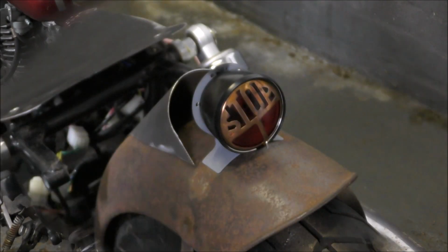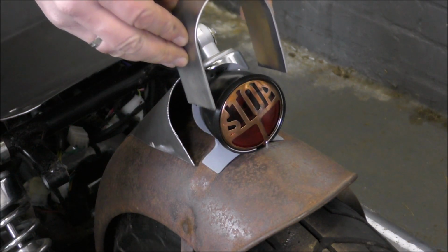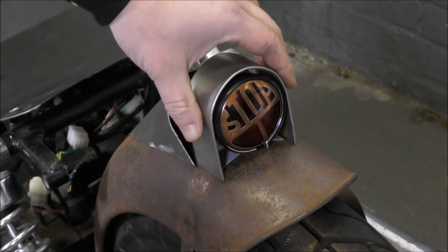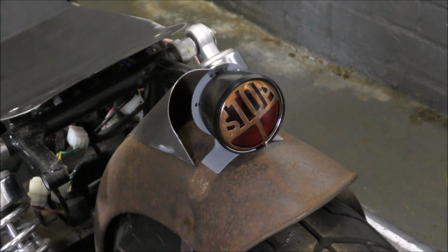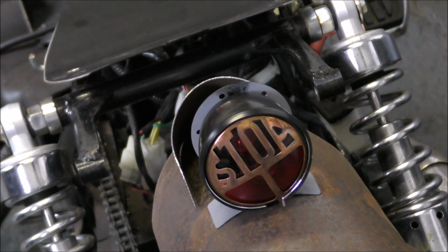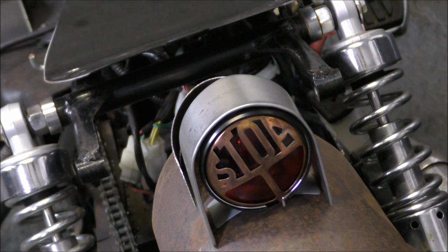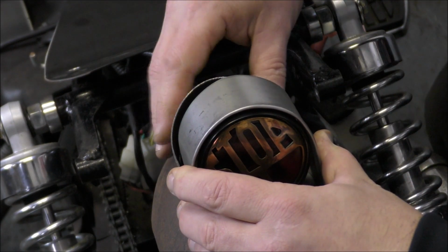Okay. So what are we thinking? Too small or not enough? Well, it should be too big. Ooh, look at that. It's actually pretty close. About another 5 mil. So I'll just shave a little bit off of each side. You use the other wheel, the flattening wheel, rather than the grinding. Okay, so you've had a shave. Are you confident? Yep. Well then. Oh, look at that! That is spot on. Fantastic. So, with that on there, and that back there.